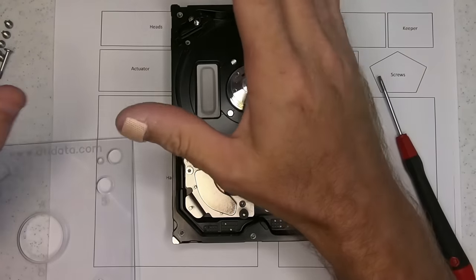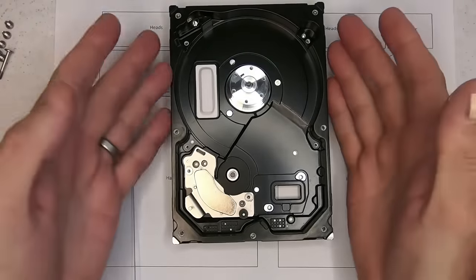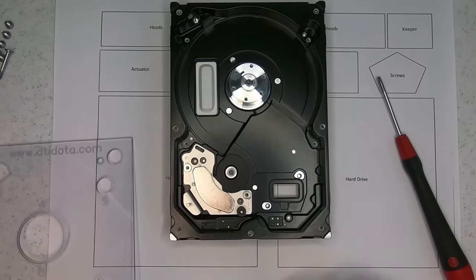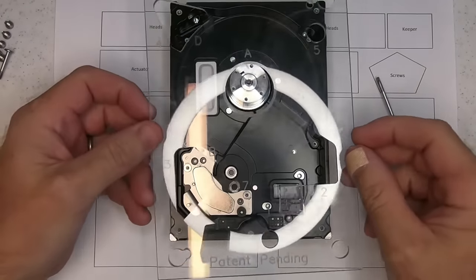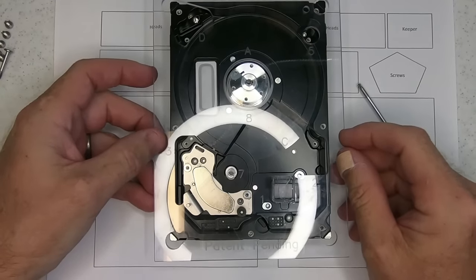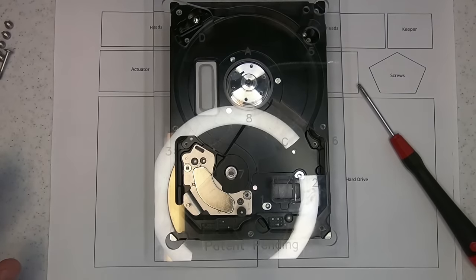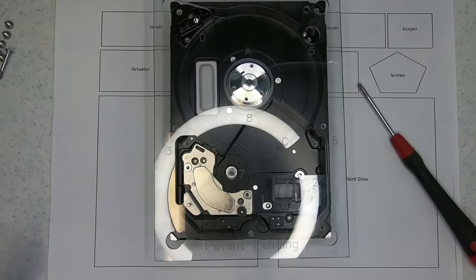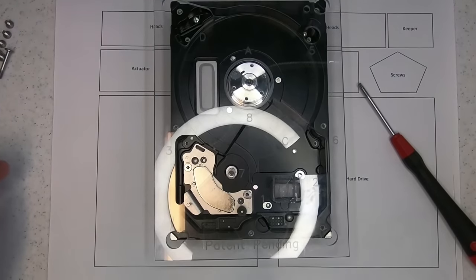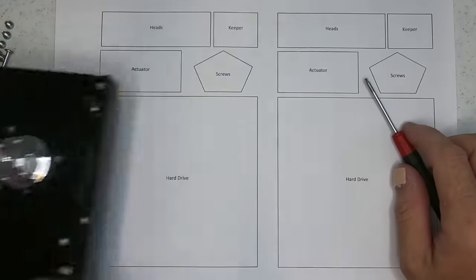So instead of changing like a platter swap, what we're going to do is we're going to replace the base, which is this part of the hard drive assembly, hence the name Base Replace. And what this does is this aligns to the drive and enables us to tack down parts of the drive that we want to have no movement on, etc., so that enables us to replace it. So I'll go ahead and start this process, and we'll see what comes of it.